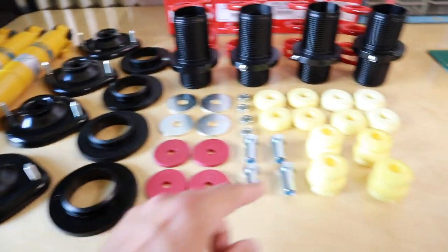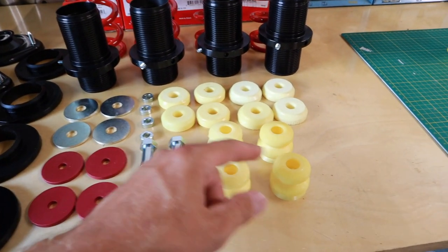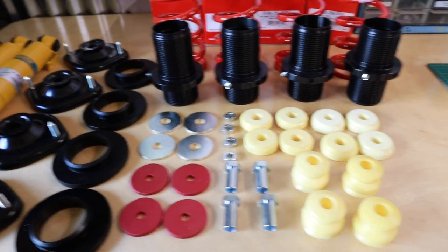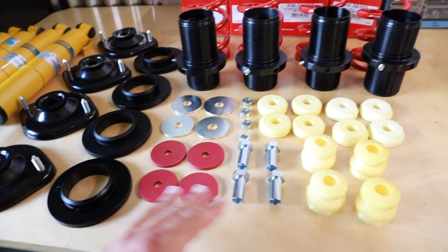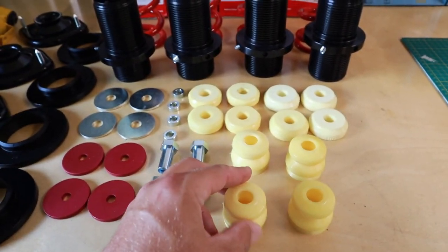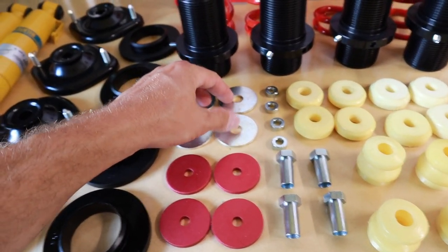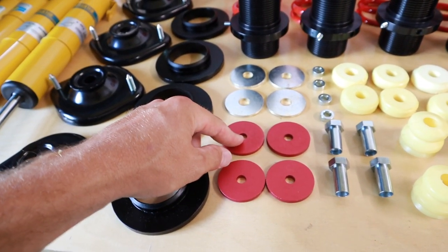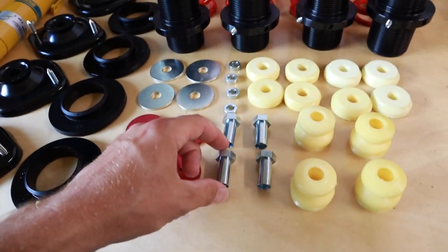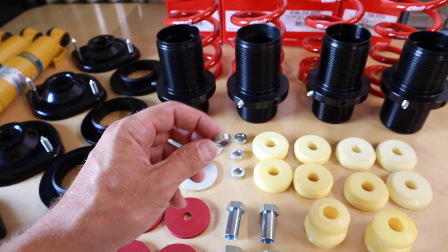These NB mounts were chosen as the top shock mount of choice for spec Miata around 2007 when they adopted the Fat Cat Motorsports shock mount kit. Moving on, the Fat Cat Motorsports shock mount kit — which we at 5x Racing have expanded upon — for the spec Miata kit specifically consists of: four 36-millimeter bump stops, four upper shock mount bushings, four lower shock mount bushings, four top washers with an M14 hole, and four perch washers with an M10 hole to go over the Bilsteins.